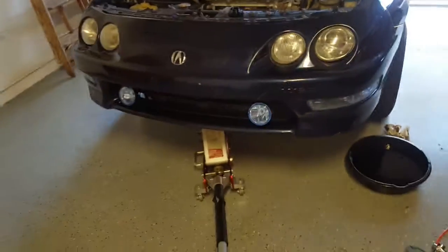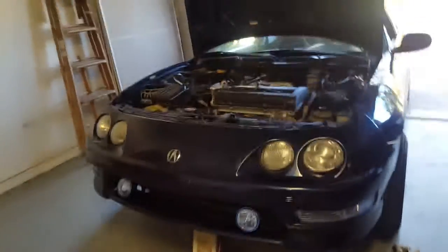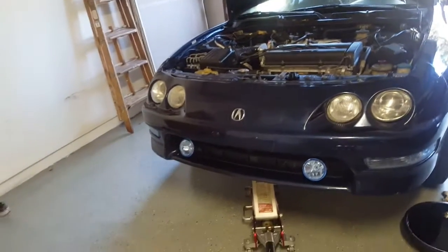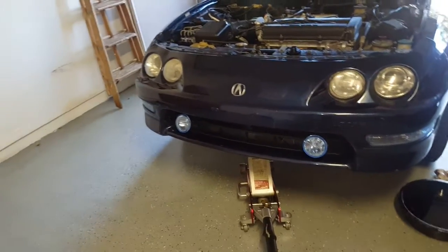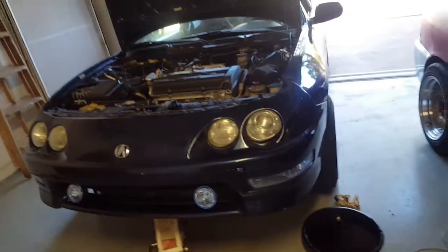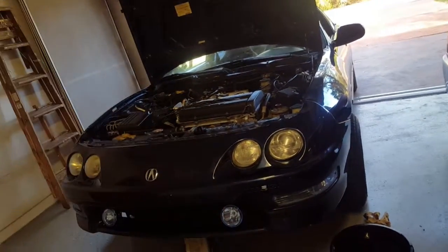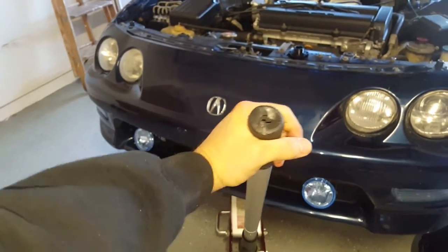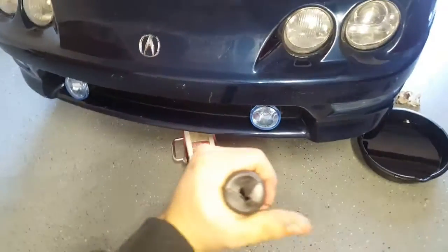Now we're back up here. We're all finished with the draining aspect of it. For those of you using the jack stands, I'm gonna go ahead and lift your vehicle again using the hydraulic jack. Remove your jack stands and then drop it down using the counterclockwise technique as I showed you guys on the jack handle earlier. Now make sure you don't drop it all at once, that way it doesn't fall on the floor and start bouncing. And do it very nice and softly, small turns, stabilized hand. Nice and steady.